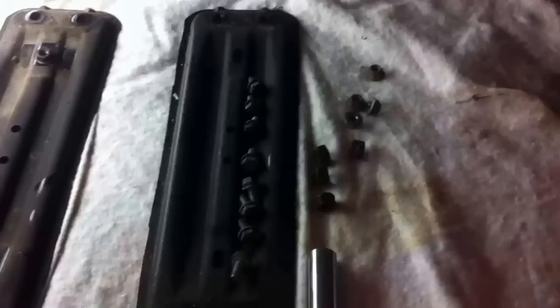The next thing that you have is these two plates. We're taking this video, as I told you, with the exhaust off so I can show you where all the bolts are. Those are the four nuts. We just removed the 15mm nuts, and then you have these two plates that are right in the middle of the car.